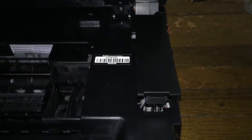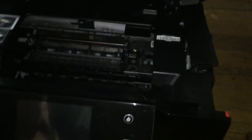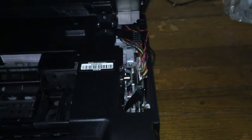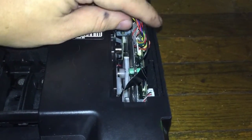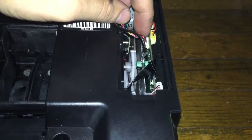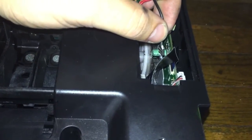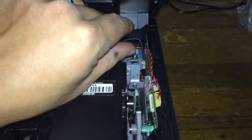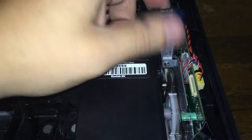To remove the scanner first, we have to disconnect the wiring. There's a little panel here that you just push this clip on — it's on the right side of the printer. If you're facing the printer, you just pop that off. Then you'll want to remove this bundle here, which connects to this connector right here, and pull that off. There's a grounding wire that's hooked onto this frame right here — just pull that off. And then the ribbon cable, which is plugged into this brown one right here — disconnect that, and then all your connections are free.